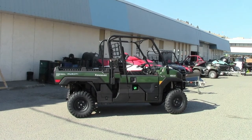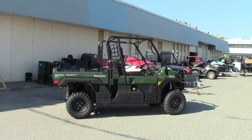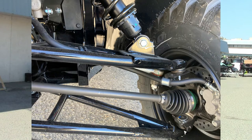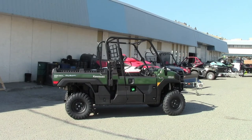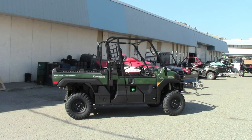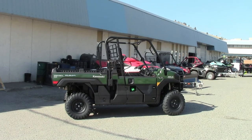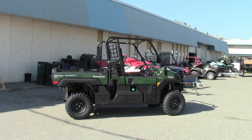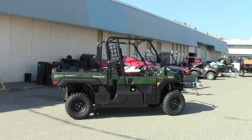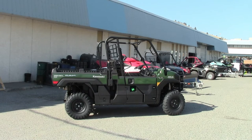You're still going to have the ladder type tubular steel frame on this. You're going to have a double wishbone suspension on the front with 222 millimeters or 8 inches of wheel travel. On the rear you're also going to have a double wishbone suspension — it's actually strange, you've got two different wheel travel heights for the rear. The left is 217 millimeters or 8.5 inches, and the right is 220 millimeters or 8.7 inches. You will have rack and pinion steering with electric power steering as well.